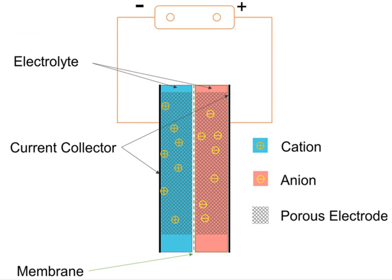Automotive. Toyota's Yaris Hybrid R concept car uses a supercapacitor to provide bursts of power. PSA Peugeot Citroën has started using supercapacitors as part of its stop-start fuel-saving system, which permits faster initial acceleration. Mazda's i-ELOOP system stores energy in a supercapacitor during deceleration and uses it to power onboard electrical systems while the engine is stopped by the stop-start system.